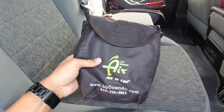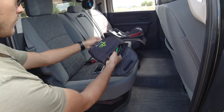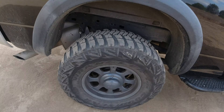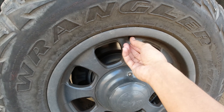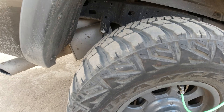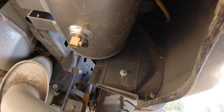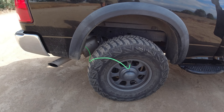Now that I've had the up-down air system installed for a while, I figured I'd make a video for it. So far it's been working flawlessly, and it makes it really easy to use. We just got to this dirt lot area, so I'm going to go ahead and air down. The first thing we want to do is grab our up-down air bag — this has all of the air tubes we're going to need to let air out. Now that we've got one of our air tubes, we're going to head over to the tire, take the air cap off, stick that on top of the tire, take our little valve here, push it on and give it a quarter turn, and then plug it into where the actual line goes.